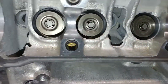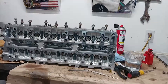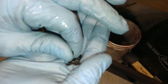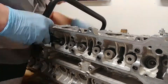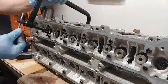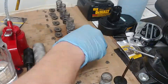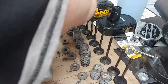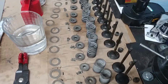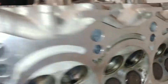Okay, there's the exhaust valves — everything's good to go, no retainers lost. If this was an L-series I'd be done, but it's a 2JZ so I've got 12 more. This is the reason why I did my valve seals. Got all the intake valve hardware out. The bigger valves mean the suction cup can hold on to them pretty well.